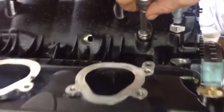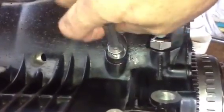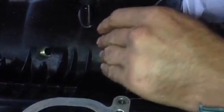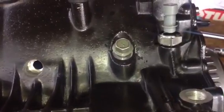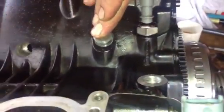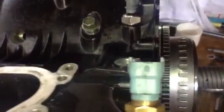Okay, so we've got the head torque down. Now, as I showed you before, remove the cap and this will reveal the crank lock position — that's closed, that's open. So we're going to put a single bolt in there. There is a tool that you get, but this one works just as well. Once that's in place, check it and lock it down. You'll see that our tool is a little bit tapered on the end. Okay, so now the crank is locked down.